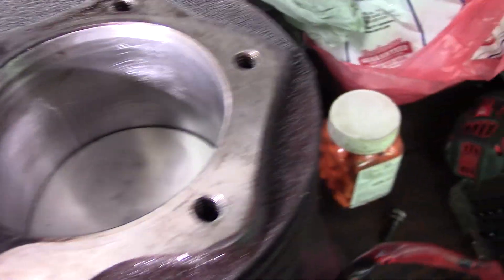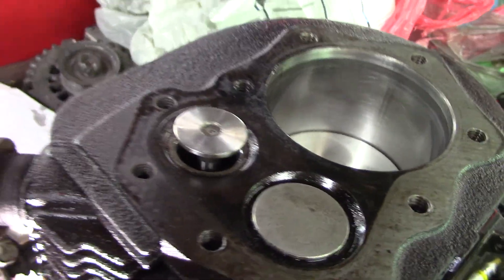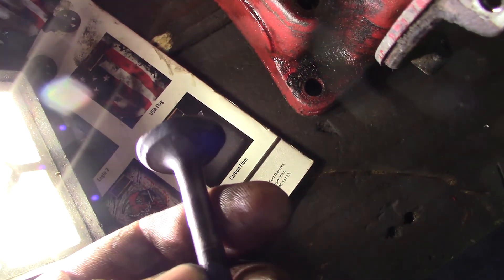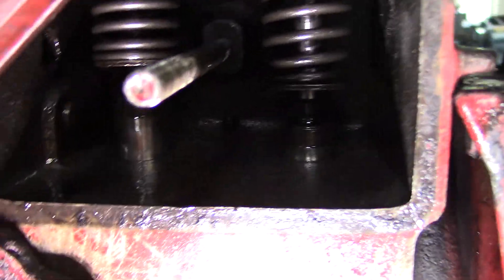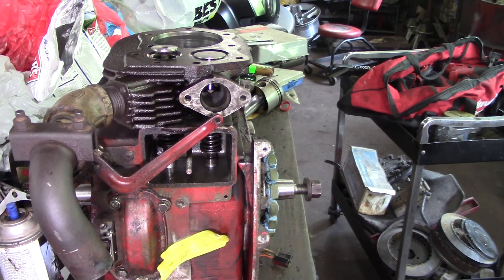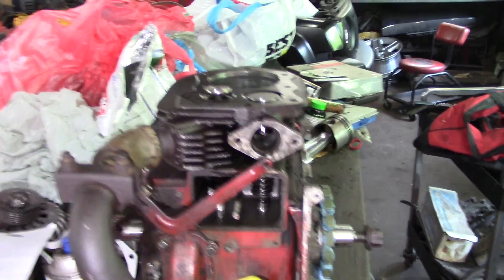There are the cylinder walls on this. Piston's installed. New valves — they were burnt really, really bad. Let me show you the intake valve. You can see that intake valve; it's all burned up really, really bad. Cool thing about these motors — these are adjustable. This side's the intake. The intake side is 8 to 10 thousandths play or clearance, and exhaust is 17 to 19 thousandths.